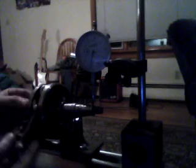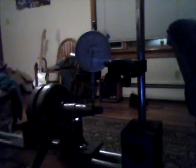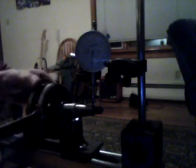Now, put it back in. Now at the top, I'm +1. At the bottom, I'm 1. Actually, it appears that I've gone 1/1000th too far, but I'm within 1. I'm not going to worry anymore about it. Now, let's do the other one. That's actually pretty close, because normally I sit here for like a half hour doing that. That's good.